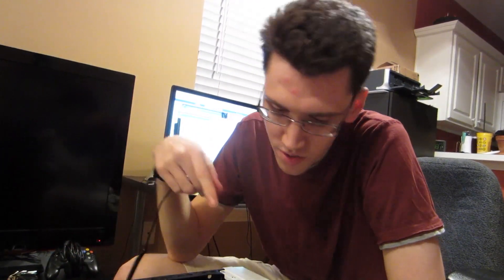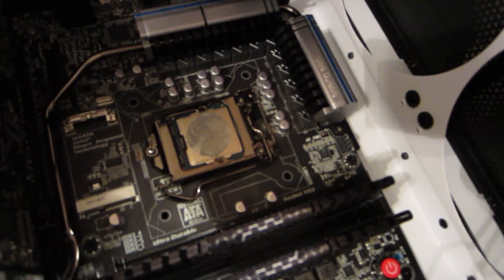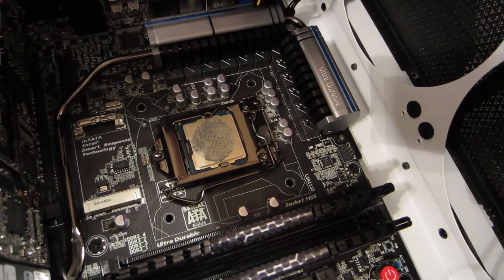The next step is to clean off the CPU. Once you clean off the CPU and get the old stuff off, you can apply the mounting bracket, get the heatsink ready, and then apply the new stuff — we got Arctic Silver 5 for that. I've never done any of this before, but I've been reading up and watching some videos. What I've read is that instead of buying expensive thermal paste remover, you can just use isopropyl alcohol. People recommend different percentages — most said you want as high as you can get, 99 or 100 is best. We found 91. I'm sure this will be fine.